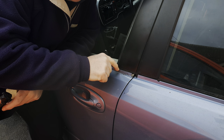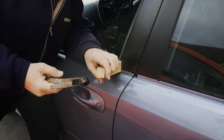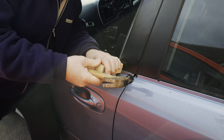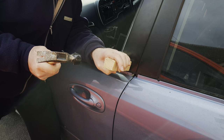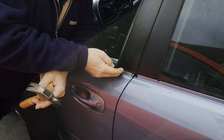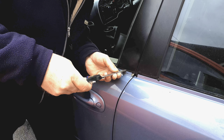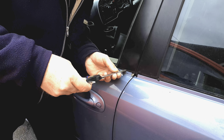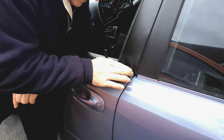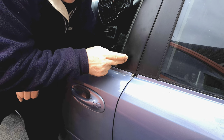I can't get my tool in here to push this flange closer to the door frame, so I'm going to use a block of wood and a medium weight hammer. Make sure you put the block of wood square, then lift this end up ever so slightly — that way you're hitting the top end and it'll bend along that bend there. Keep checking your work as you go. I've now managed to get a nice consistent gap of between 5.8 and 5.9 millimeters along there. You are only tickling it just to move it in ever so slightly so that you get better contact between the seal and whatever's behind it.